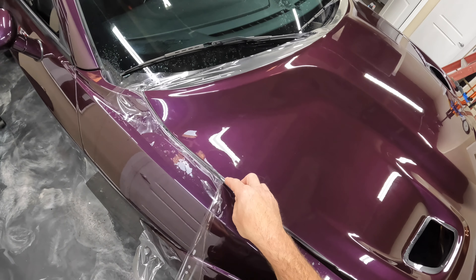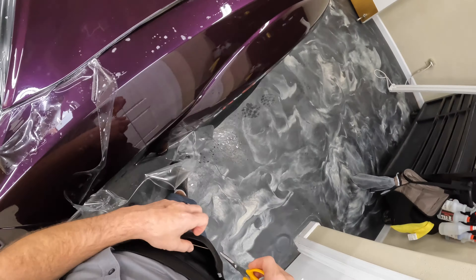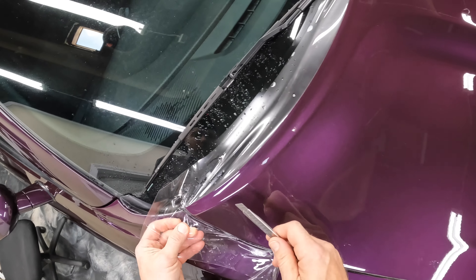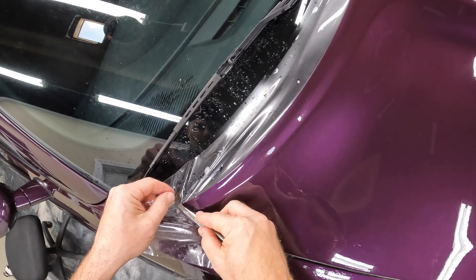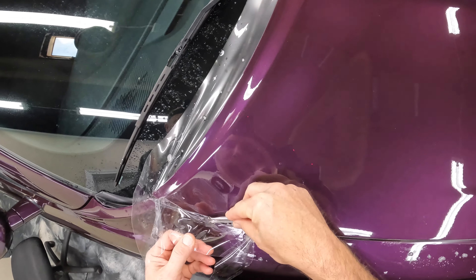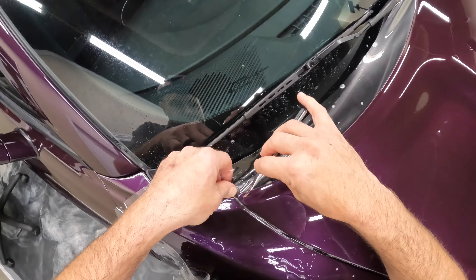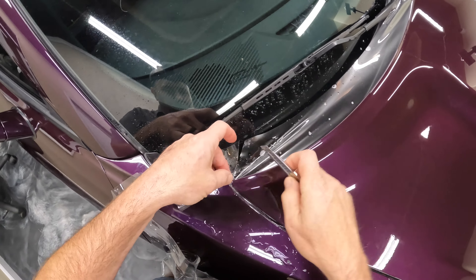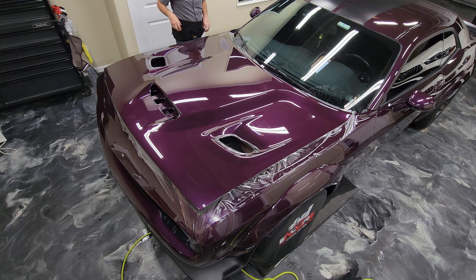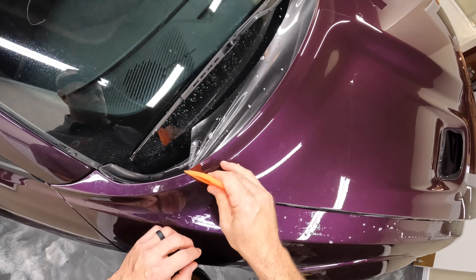So you'll see there that I'm pulling away with the material — with my left hand, I'm pulling away with the material. And that's an important step when you're trimming this stuff. If you let it hang there and you don't have tension on it, it's just going to bunch up on the other side of the scissors. So it's definitely important that you keep that tension on it. I found that pulling it straight out with some tension works well, as well as pulling it a little bit towards me — maybe a 45-degree angle away from the hood.